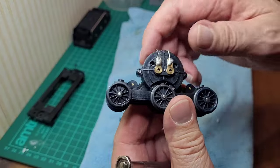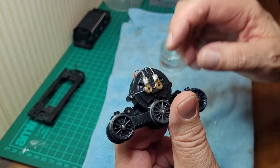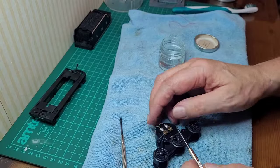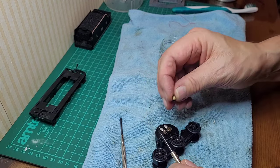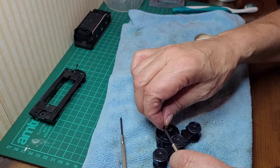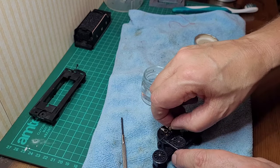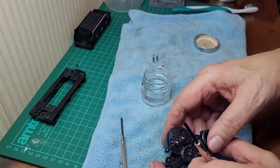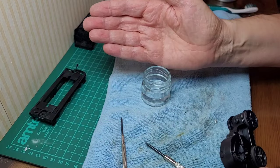I went over the motor, sprayed it and let it air dry, then used a cotton bud to wipe it all over — there wasn't an awful lot of dirt. The brushes look like they're behind here. I can lever them out with a screwdriver and pop the brushes out for a clean. Got a little jar here with some cleaner — the spring goes in as well. Both brushes have dropped out, so I'll pop them in and let them have a soak.